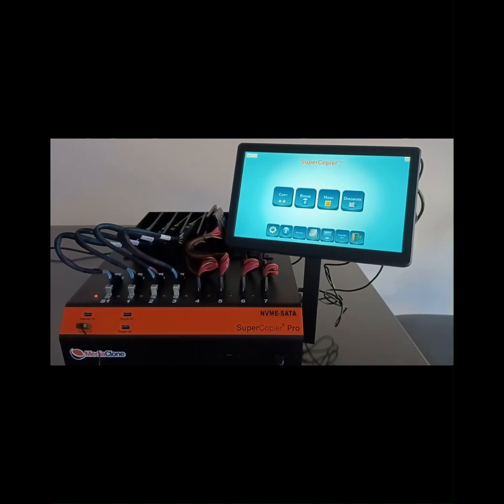This process of connecting NVMe SSDs at boot time is special for NVMe ports since they are pure PCIe storage. Also, if an NVMe SSD contains a bootable image like Windows, the BIOS will try to boot from the NVMe SSD instead of the unit's internal storage. That depends on the unit's motherboard. If that happens, the user can access the BIOS of the unit at boot time and change the boot sequence to boot from the unit's internal SSD.